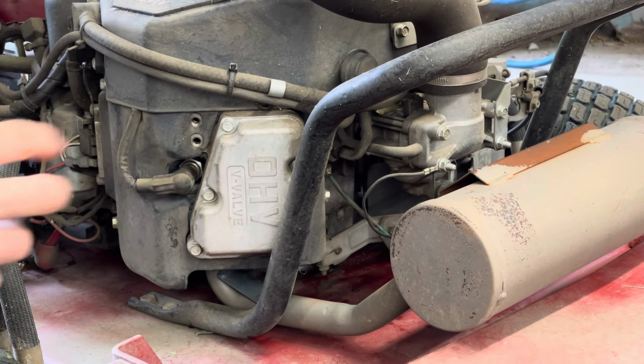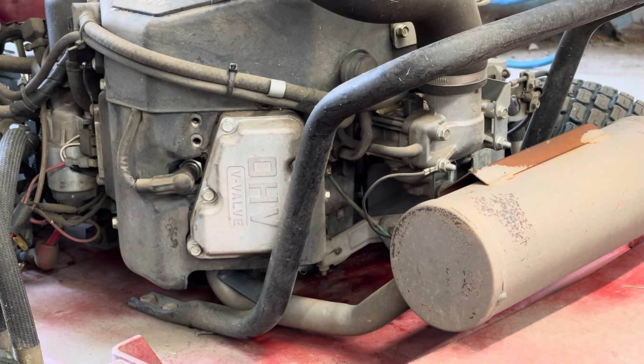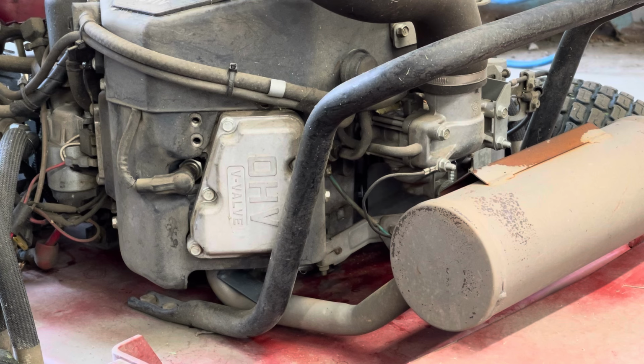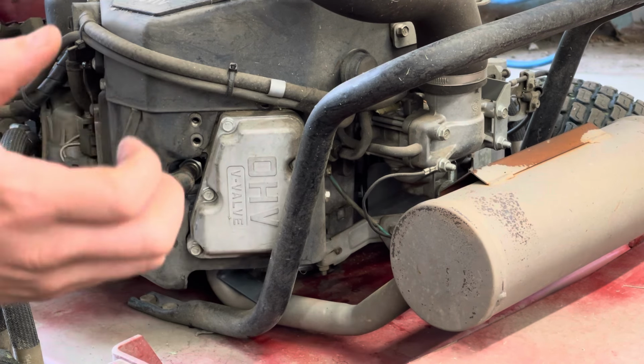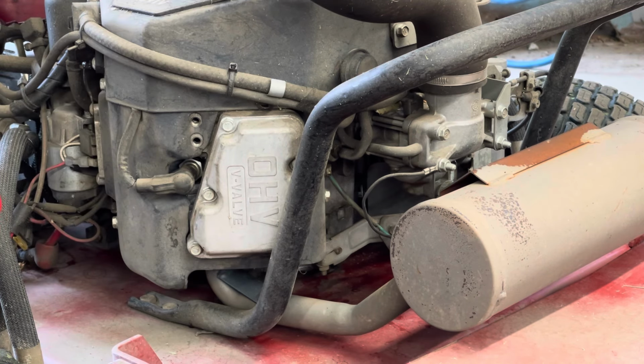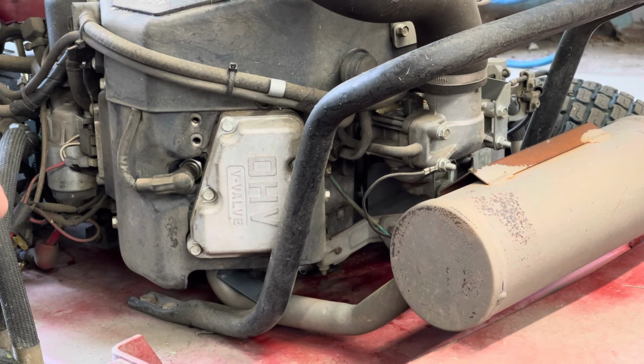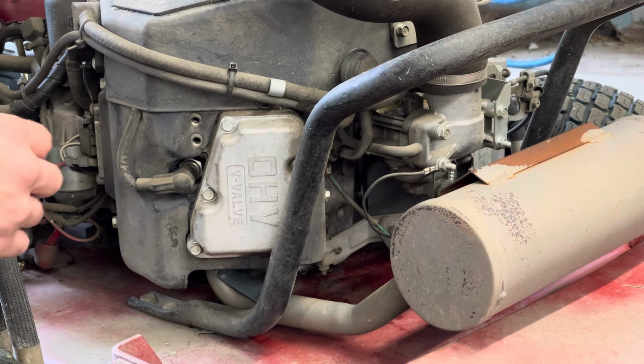Okay, so what I believe is happening and what I could hear is a single cylinder misfire. Engine can misfire for a multitude of reasons. Generally, you go by suck, squeeze, bang, blow is a good way to remember it. It's got to be able to suck in that fuel mixture. Squeeze, it's got to have compression. Those valves have to shut. Bang, again, correct mixture. Spark plug has to ignite. And then blow, exhaust valve has to open, okay?